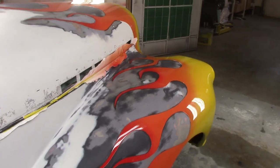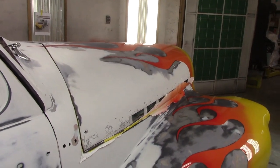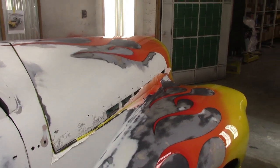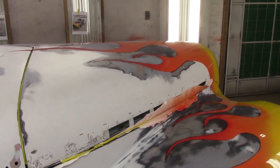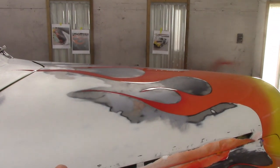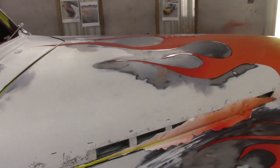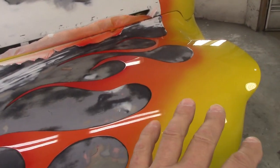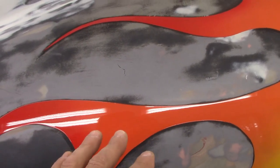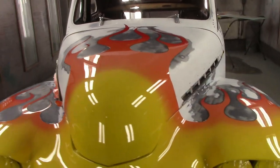We felt it was easier to do it this way because if you have a screw-up when painting the color — if we would have had the car satin black and you have a screw-up, how do you fix it? It's really tough on this one because the car is going satin black but the flames are shiny. If you spray the black and then do the flames after and a little bit of overspray lands somewhere on the car, it's not like you can wipe it off. The vehicle is done in satin clear, and when you try to color match these flat and satin colors again — good luck with that. So it's way easier to paint the flames first; if a little bit of black ends up on a flame, we can always wash it off way easier.